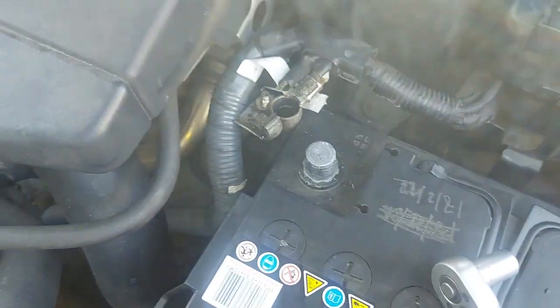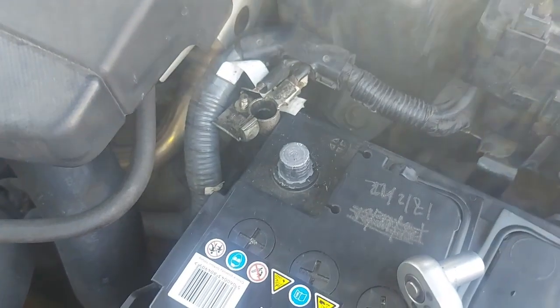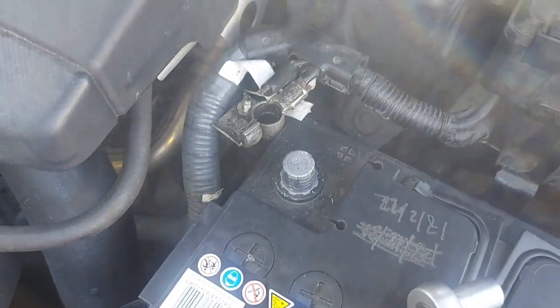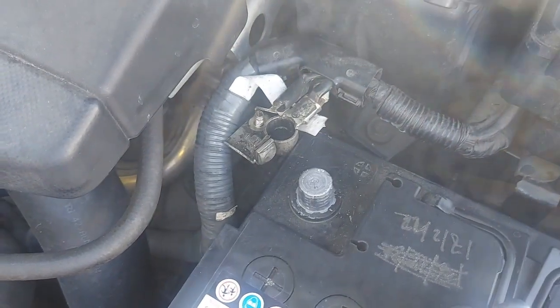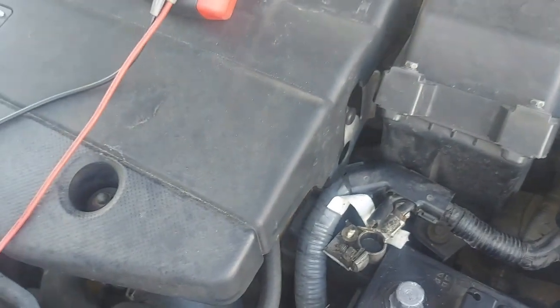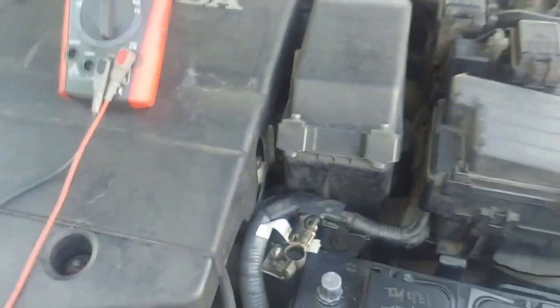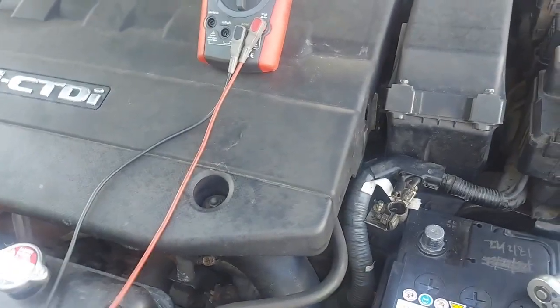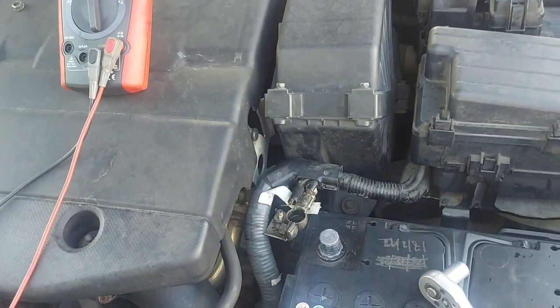I thought about it later and said, hey, let me just check this wire for a short to ground. So now we've confirmed the short to ground. Please guys, this is important now. I wasn't testing an open circuit here. I'm testing a short to ground. Disconnected both sides. Touch your ground. Or maybe you might say I'm touching the battery.